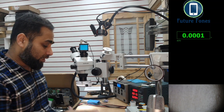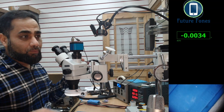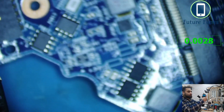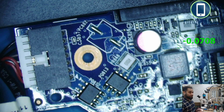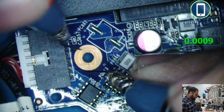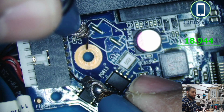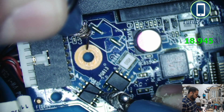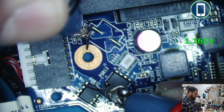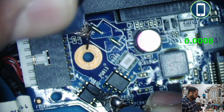To check the board, I'll take you into the microscope. The battery and charger are connected. First, we check that we have 19 volts coming into the charging port — and yes, we do. That 19 volts goes into the first MOSFET. We check it, and yes, the voltage is getting through. The gate power supply on this MOSFET reads 3.0 volts.